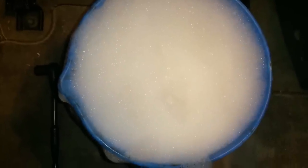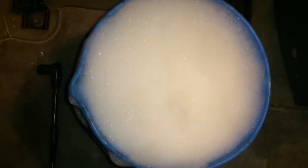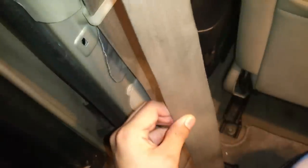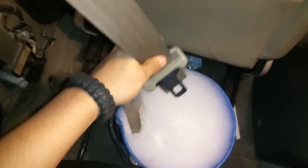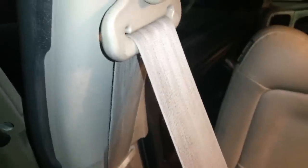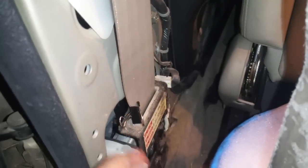Since the seat belt is still retracting a little bit slow, I'm going to leave it overnight in some water with soap. This is just going to break down all the dirt that has accumulated on the seat belt. Go ahead and put your seat belt in there, and you want to get a clip to stop it from retracting. What I used to stop it from retracting is a paper clip holder — I clipped it right here and that kept it from retracting.